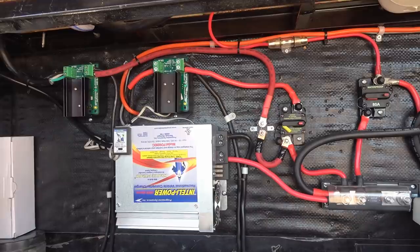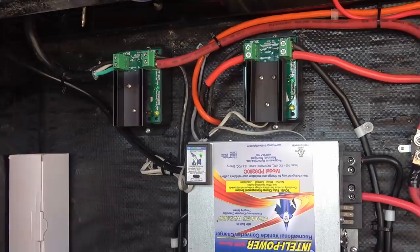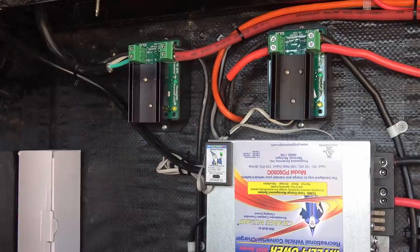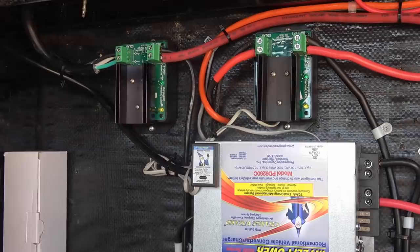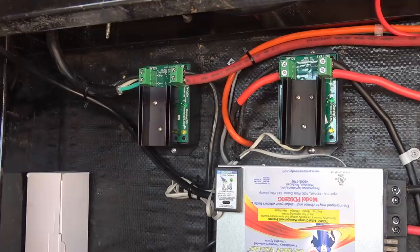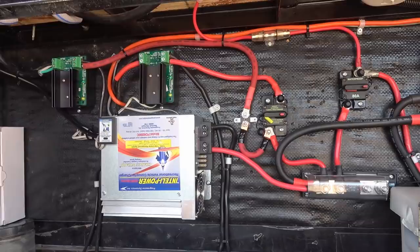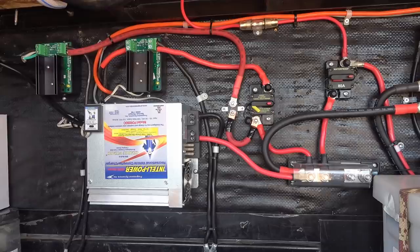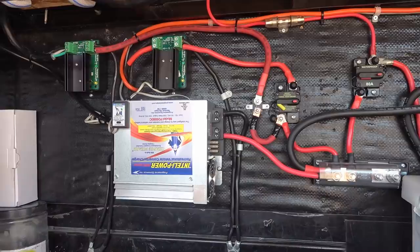As for why I didn't put in a solenoid — I just don't want to introduce that complexity right now. The only risk is draining the truck battery if we stop for a long period, but I have the switchable breaker so I can turn it off, and unplugging the plug stops the flow anyway. Also, when I stop the battery drops to about 12.8 volts and I don't think there'll be enough voltage to push current through the system. I may add a solenoid in the future. Work in progress — thanks for watching! Ray from loveyourv.com, cheers everyone.